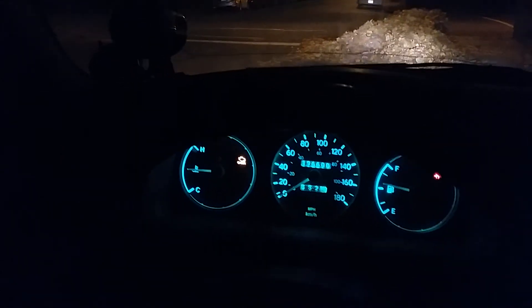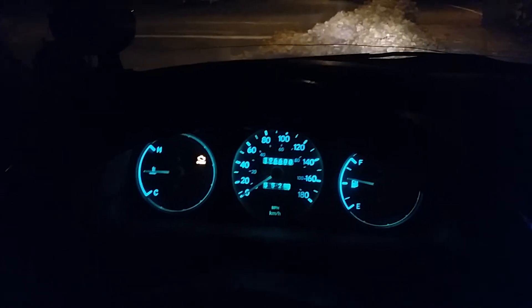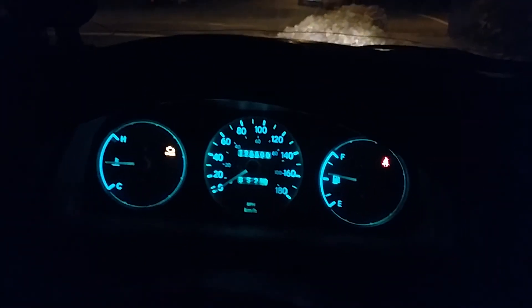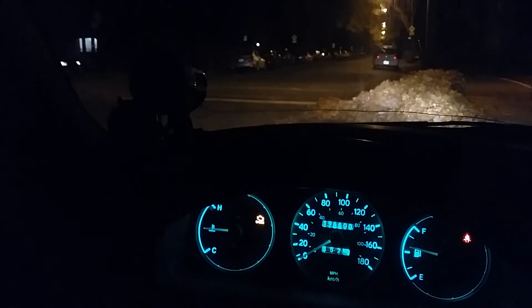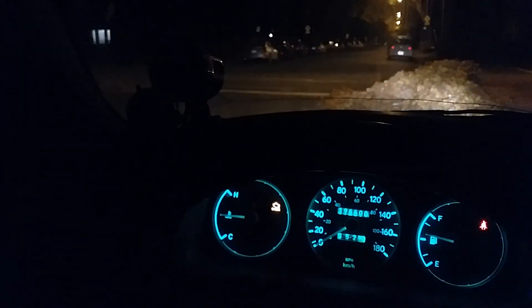It's a really nice car. I wish I had my RPM gauge working — I did get it working though. I found the ground wire directly off the ignition coil and tapped into it. I also found a port I could plug into on the control module where I could connect the green wire. I have the positive and negative — the ground is grounded to the frame properly for both the LED light and the gauge.